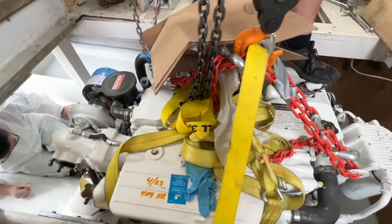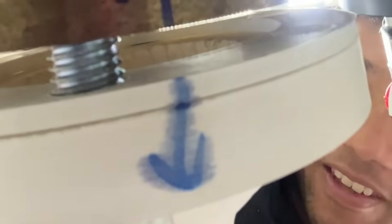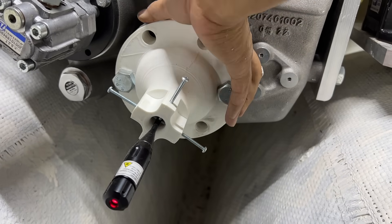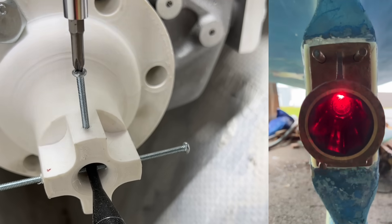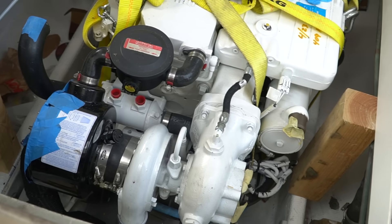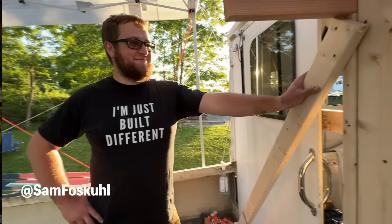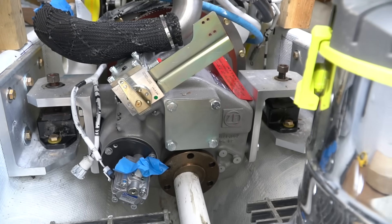It's getting so close. I need to tweak this a little bit more. For total amateurs, I've just been reading around the internet, and apparently we're supposed to get this engine within about three hundredths of an inch. But I misread that and I thought it was three thousandths of an inch. So with feeler gauges we got it extremely close, and the expert came out and freaked out because it was a lot closer than most people typically get. Credit is due where credit is due — Sam is the one who really figured this thing out. That engine alignment is spot on. Saved me a lot of money and time because boat people are not cheap to hire.